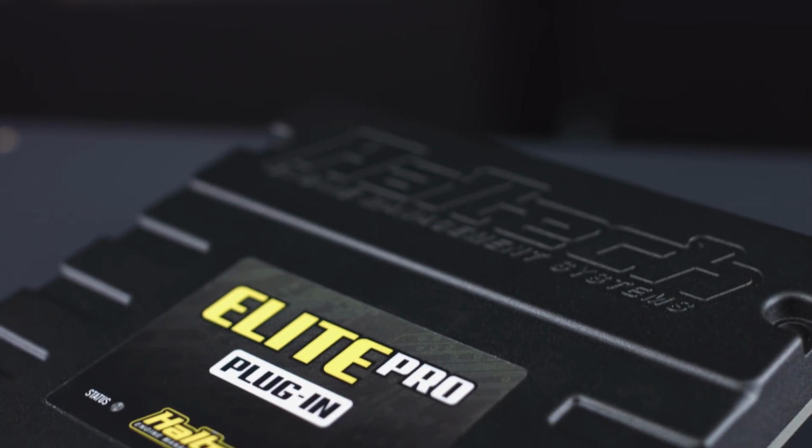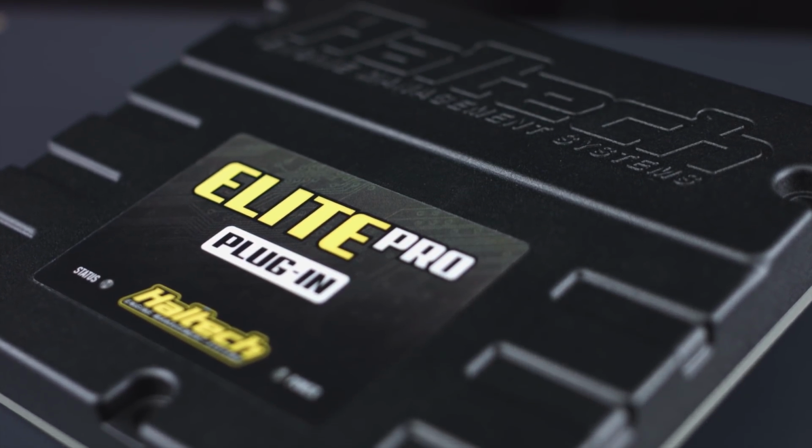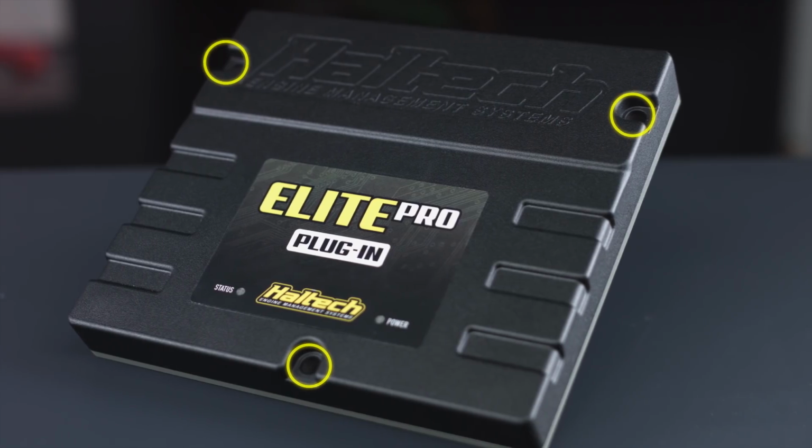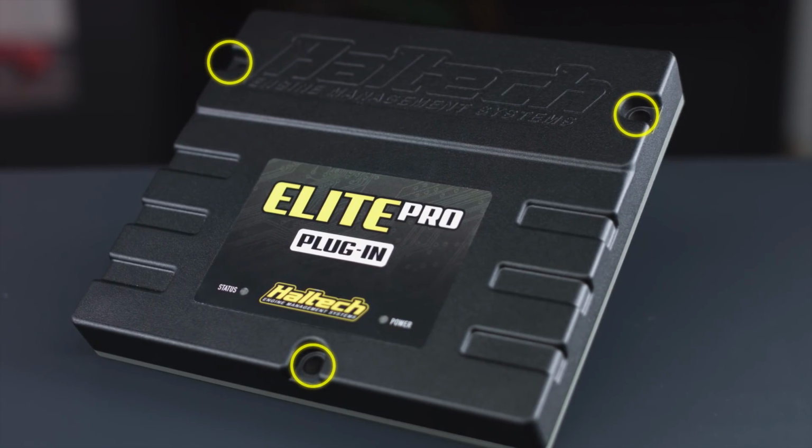Next up, the ECU itself. The first thing you'll notice about it is its size. This ECU is physically larger than the Elite 2500 ECU. That's because it's a direct plug-in replacement for the OEM Ford ECU, so it has an identical footprint for the mounting holes as the Ford ECU does.